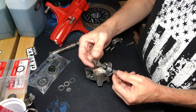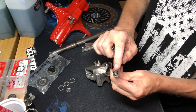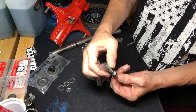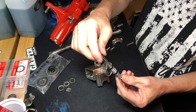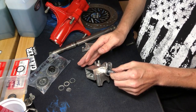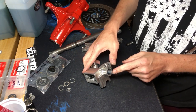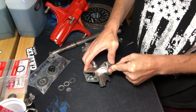Next we're going to put the piston back in. The small side of the spring sticks onto the piston right here and this just slips inside. When you replace these seals, you want to make sure the cupped end is facing in - because when you push it in you want it to push fluid, so you want it to be like this. When you let go you want it to come out with the least resistance. Anyway, let's get this baby oiled up again and push it right on in here. You want to wiggle it around a little bit to get it to pop in - you don't want to just shove it in there because it'll flip the seal over. Be very careful. Same with this one - wiggle it around until it goes. That's the way it should work.